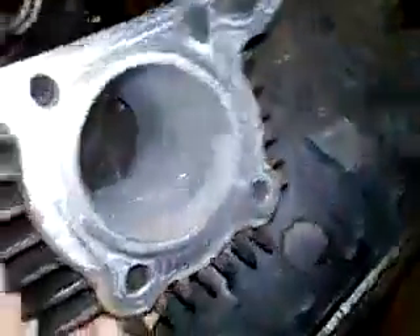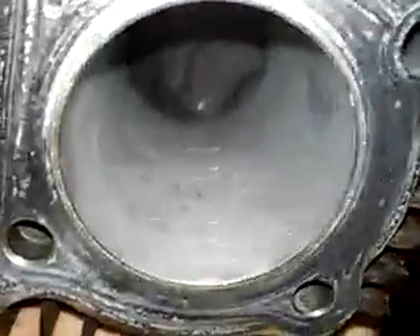This is a 2002 Raptor 80. I'm not gonna do a whole video on this. I bought it — the motor was froze up. You can see the piston — water got down in there. The pipe looks like crap too, we'll have to burn that out. I got the old cylinder off and tried to hone it, but I noticed there were a couple of bad spots in there and you're pretty much gonna have to bore it out to get those out.